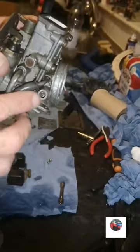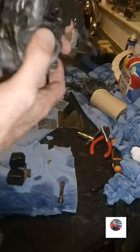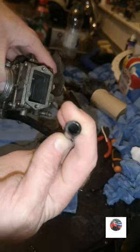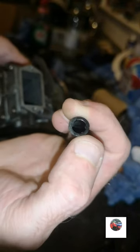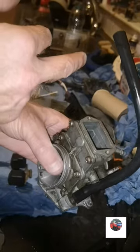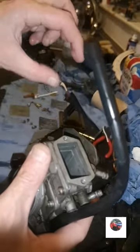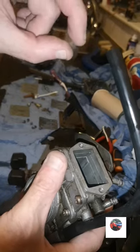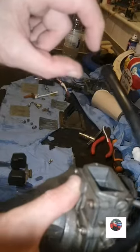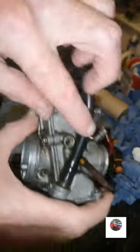And another thing, this bike hasn't got a petcock on. A petrol tap, whatever you want to call it, on the tank. But there's two kinds. The tap what fits this is the same size as that pipe. If you were to buy a petrol tap off an 88 model, the pipe's thin on the carb, because they've got a round slide carb. So if you look on eBay and you see, oh, DTR petrol tap, and there might be one on cheap, but when you buy it, it's from an 88, and the 88's is little on the petrol tank because they use a round slide carb and this bit's little. So if you buy that petrol tap off eBay for cheap without knowing it's the little skinny one, and you've got this type of carb with that big fat pipe there, you have the game putting that on.